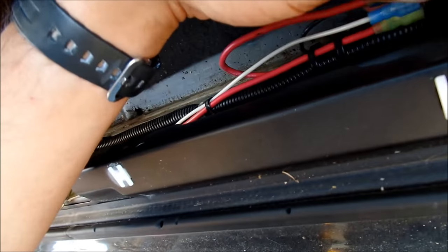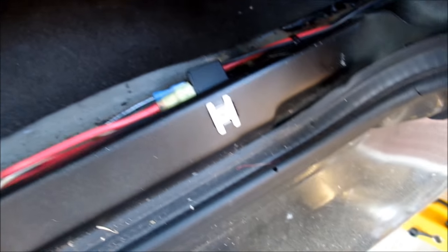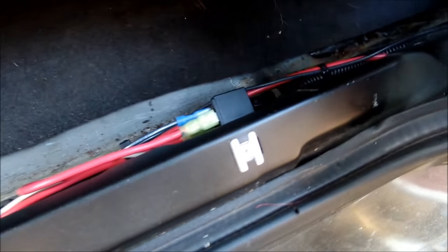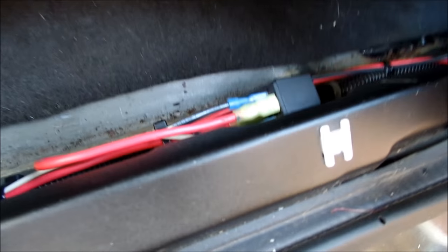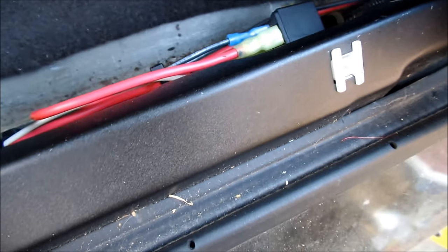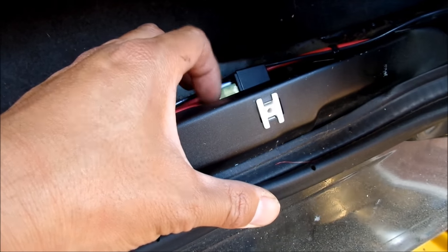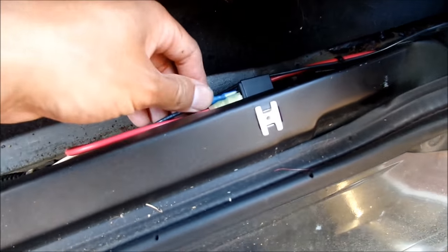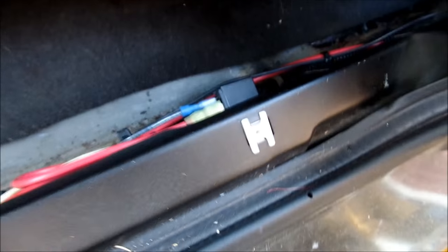There is the previous owner's handiwork — not bad. This is what they call a fuel pump rewire. I'm just not happy with this here, so I'm gonna replace it with this. The bad thing about this setup is you can get the wires wrong. If you didn't know by heart what connector to put where, you'll be left scratching your head if this ever goes bad. And I have seen these fail — I've seen the wiring come loose. That's not gonna happen with this new relay harness. Whoever did this did a pretty good job, but I'm gonna make it even better.